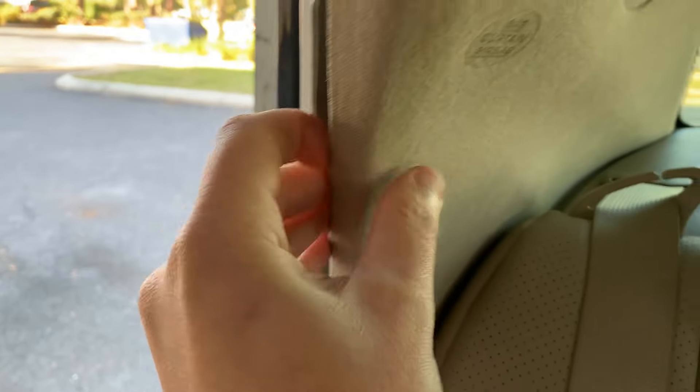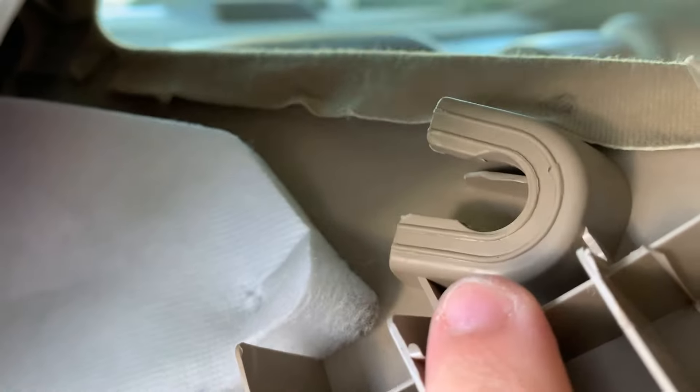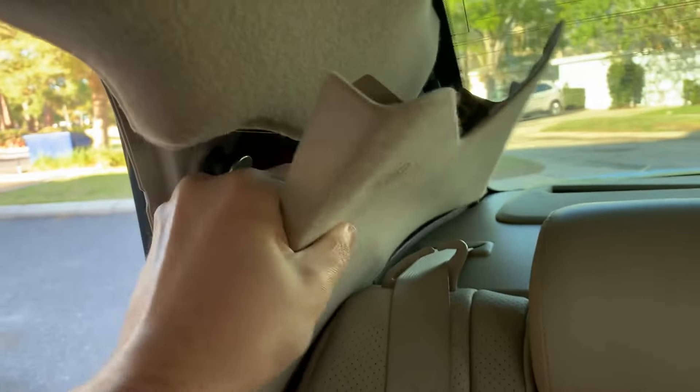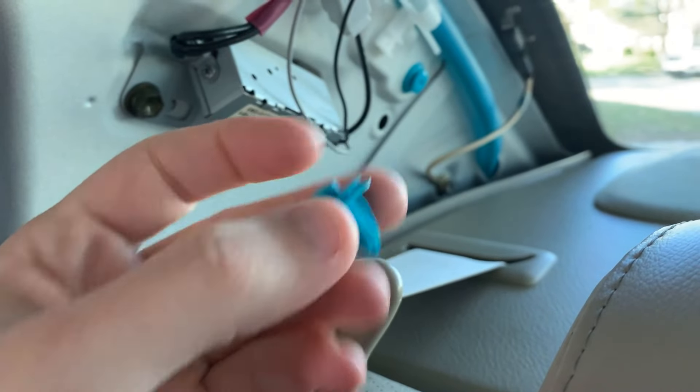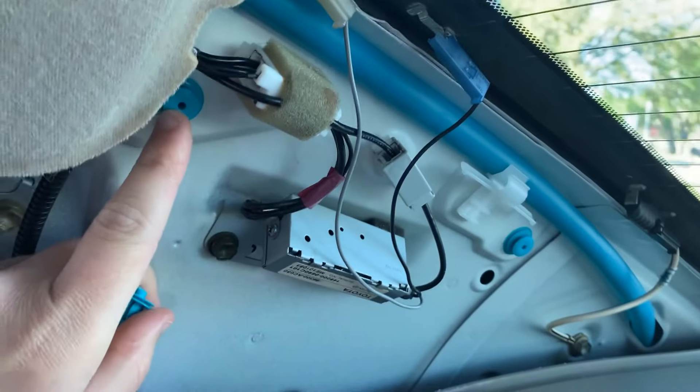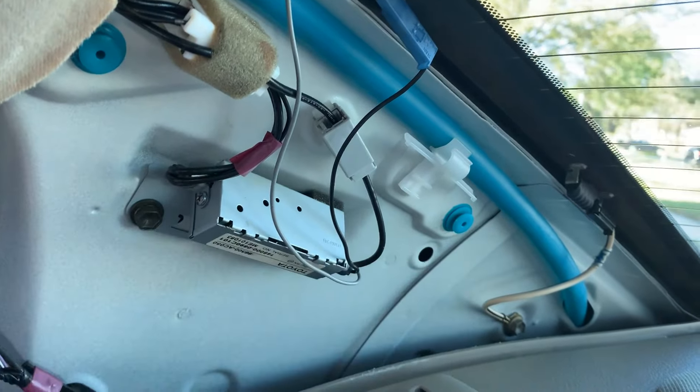For the second panel, pull slightly upward and towards the front of the car. This panel should come off easily. I've been back here a few times, so you'll see my bluish-green trim clips from Amazon. We'll need to yank these off the body before we reinstall this panel. I have a link in the description for a kit that comes with a panel tool to help you remove these. Don't attempt this job without having spare clips and a panel tool — you'll lose at least one factory clip, and pliers will break these when you try to take them off. It's worth the $10.